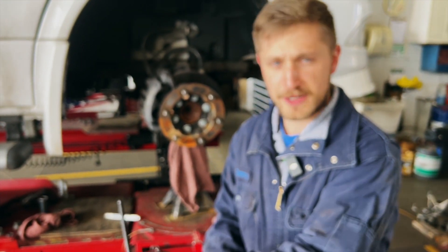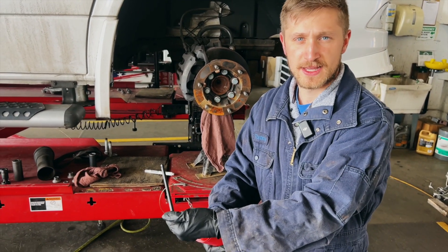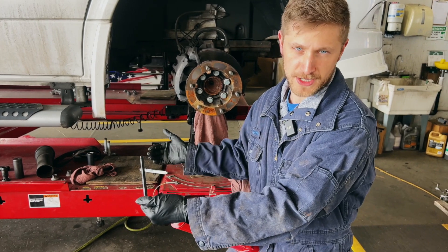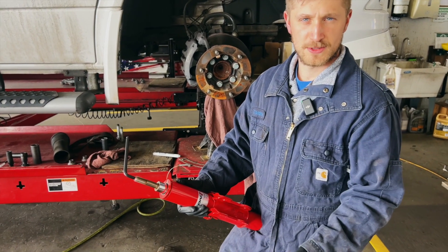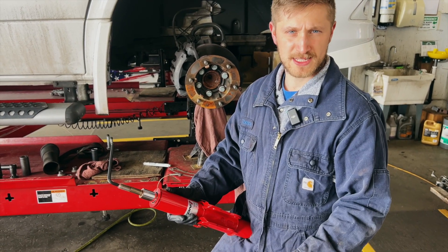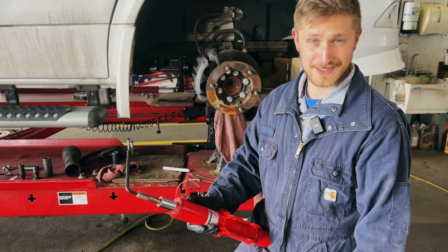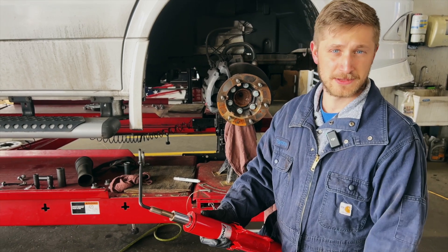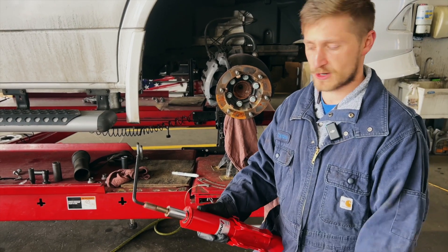So now we've got to figure out where we want to adjust this thing. We've got our reference for all the way backed off. In this particular case we're going to adjust it 50% of its total range of motion. On these struts that's about one turn, because the total range of adjustment is about two full turns. That's going to give us a good point where you'll notice quite a bit more stability compared to your factory struts but you're not going to hurt your ride quality. For somebody who wanted maximum control, I would say you could go up to 75%, which would be a turn and a half. And if somebody says they don't care if it makes it ride a little harsher and they want the most stability, you could run them all the way up to two full turns — that's actually what we do on our own Sprinter. For this customer, we're going to go halfway: one full turn.